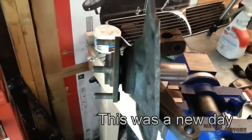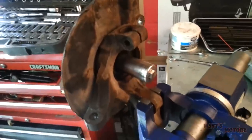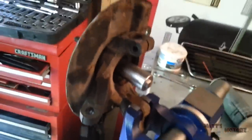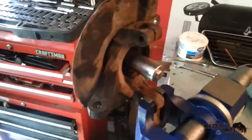I'm waiting on parts. I decided to come here to try to knock this hub out. I didn't bring my camera so I'm using my cell phone — sorry for the poor quality. I have a socket here and a little ring for the hub. I put a long bolt through it with a nut on the other end and I'm smacking it hard to drive the hub out. You could prop it up on the ground facing down and hit down — that's probably better but this is how I'm doing it.